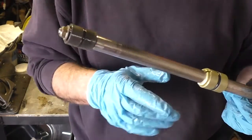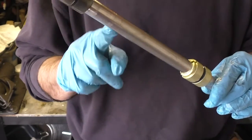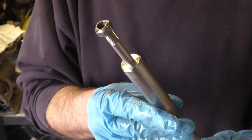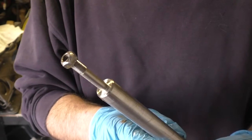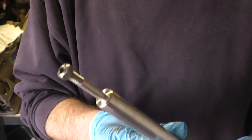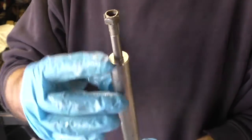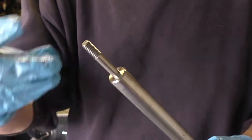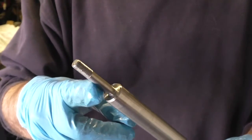First off, I would like to mention that there are two different cylinder rams for the same build, and I'll show you what the difference is. Here's one that's been disassembled, and I'm going to take a wild guess that this is the earlier of the two builds, and I'll tell you why. Generally, manufacturers like to cut costs, and I'm sure that when they machine this one piece, this is a nut that holds on that piston, that whole piston assembly, and it's a nut onto a machined shouldered shaft. It had to cost them a lot of money to make this.